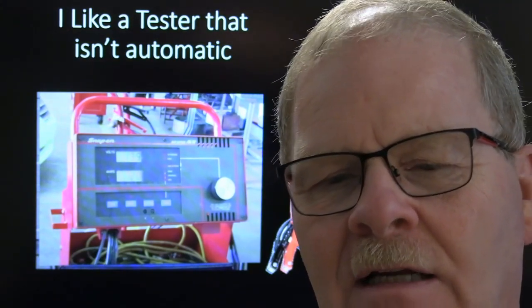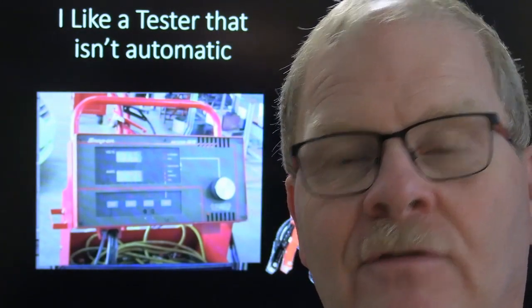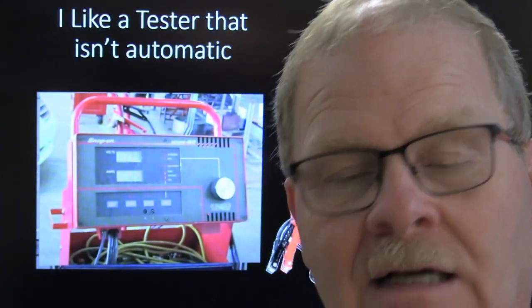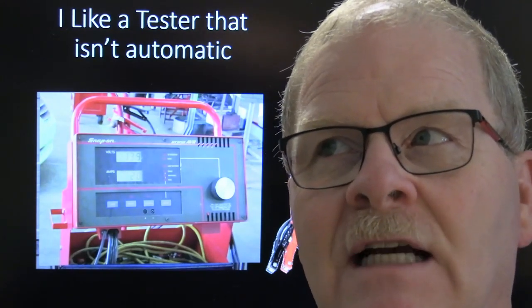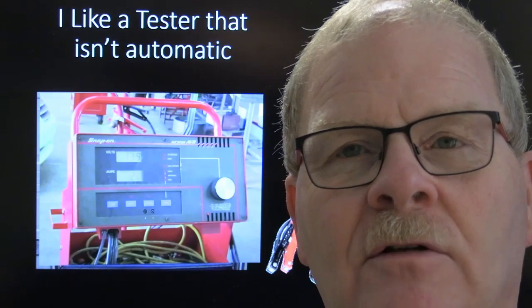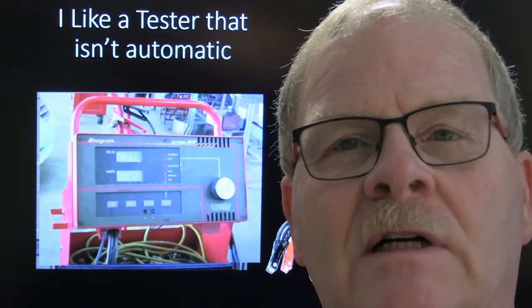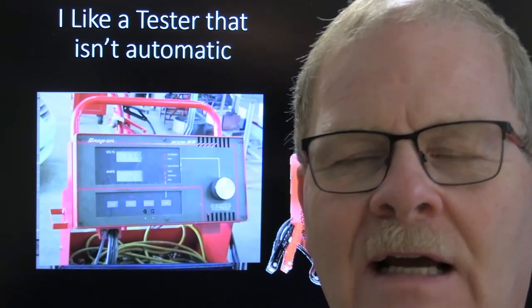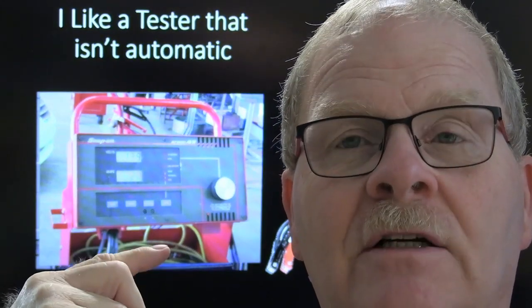But anytime you're doing any kind of charging system testing, the foundation has got to be fixed first. So work on the battery and the connections, or check those. If you're going to check the battery, the best way is to use one of those testers like Midtronics makes, or any of these other manufacturers, where it tells you how many cold cranking amps are in the battery. I got this BT608 Autel thing I love to use for that. It works really good for it too.